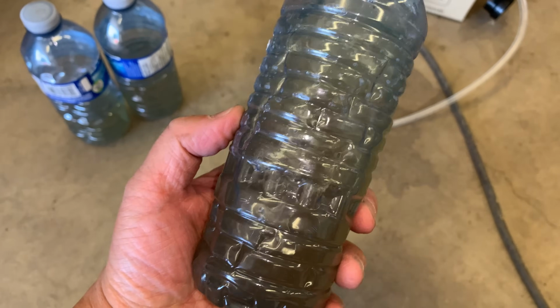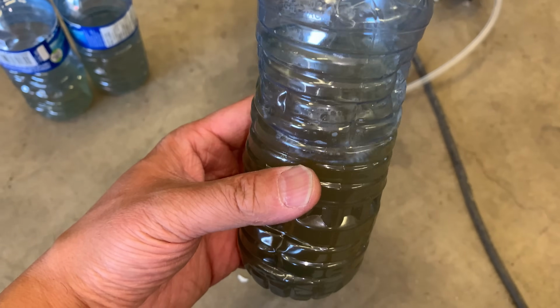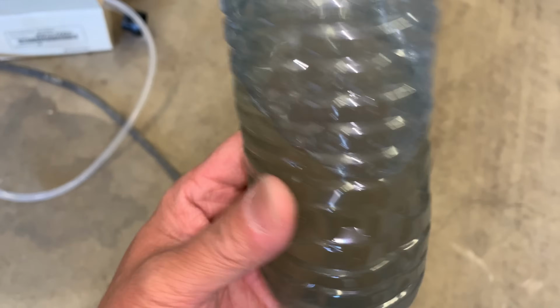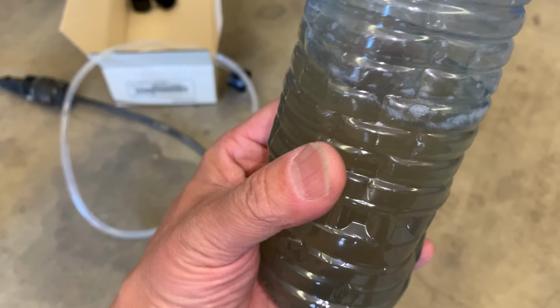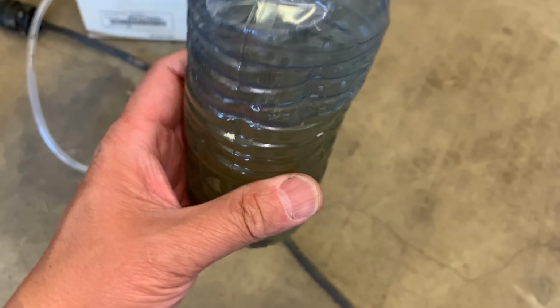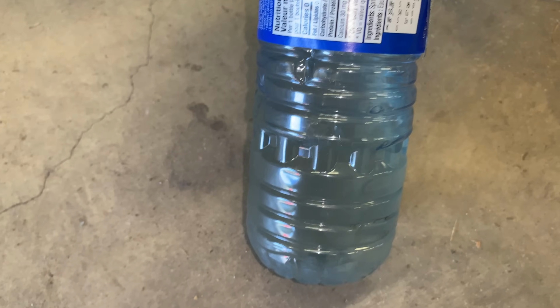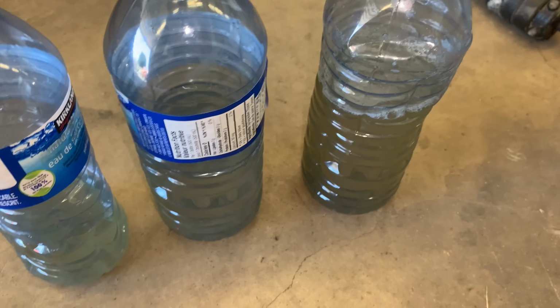So if you're smelling something musty and the cabin filter doesn't quite cut it, you might want to consider cleaning the evaporator core. This is the Toyota kit, which works quite well. I think Kia makes one. Aftermarket companies like BG sell a kit. Yeah, this is my TSX. I did my MDX the other day as well. I got lots of clean with the MDX, not as dark as this one.